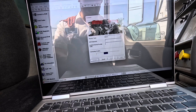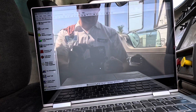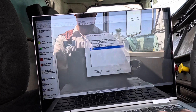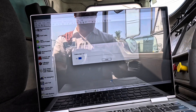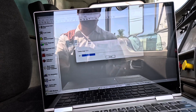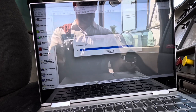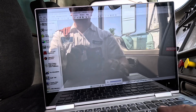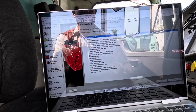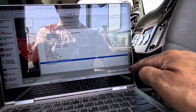Just be patient — it's gonna connect, it's gonna do its thing. The next screen is gonna pop up with the image or instance. You can either tag onto the one you had previous or create a new one. I'm gonna go with a new one for the sake of this video — click new, click okay. It's gonna go ahead and create the image, basically just connecting and communicating. Once we do that, we're gonna go over to the left side of the screen. It's a two-step process. You're gonna go to ECM diagnostic tests. The next screen that pops up — you wanna go to the second to the last one, which is your VGT actuator: VGT electronic actuator installation and calibration. Very important. Go to your bottom right, go to next.